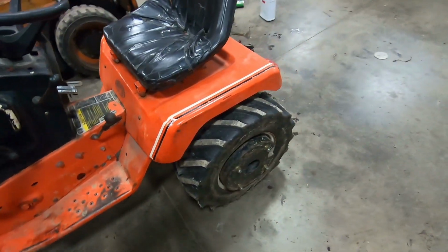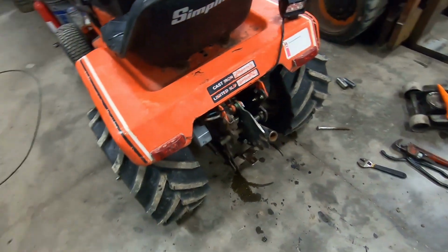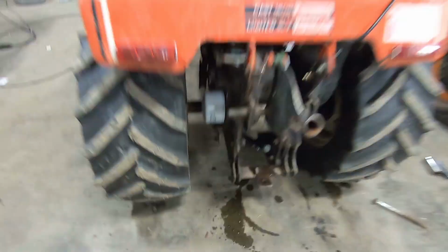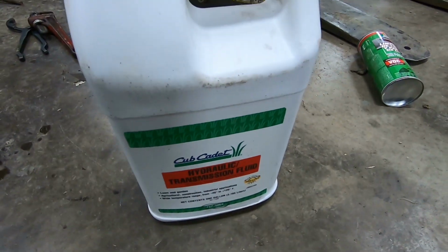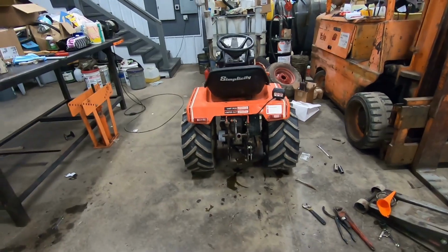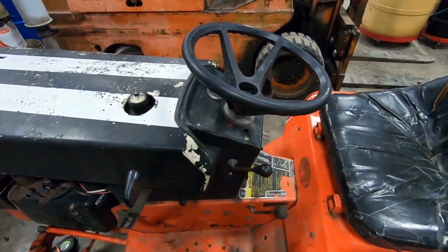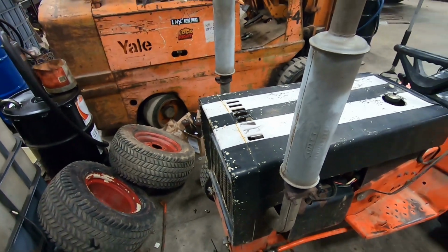We got our weights on there now. I serviced the transmission, and boy, what a difference did that make. New filter and new fluid, which I just used a Cub Cadet hydraulic transmission oil. Wow, that really brought the transmission back to life. It was getting kind of lazy and sluggish, and now it's pretty snappy, at least compared to how it was.